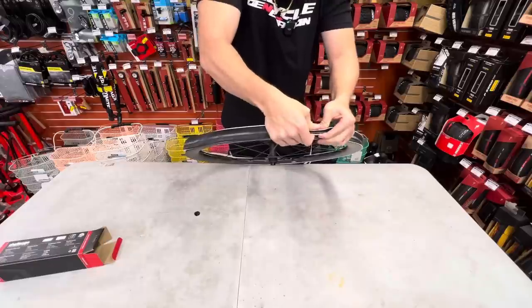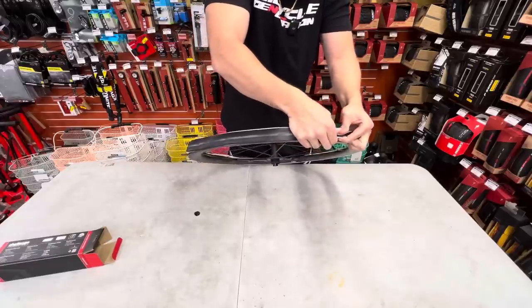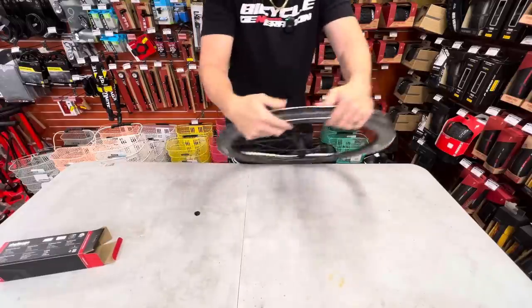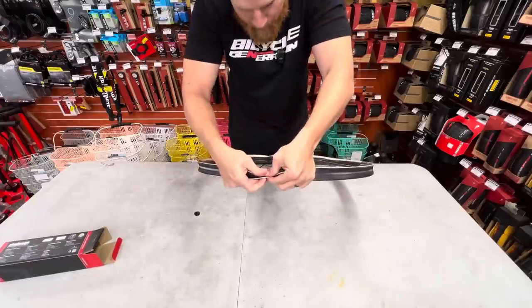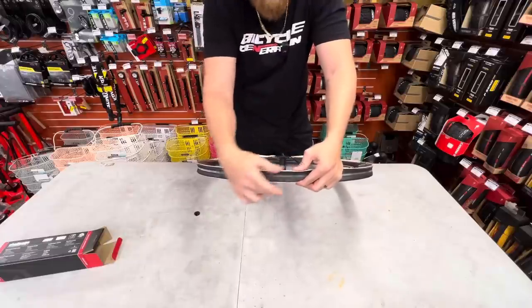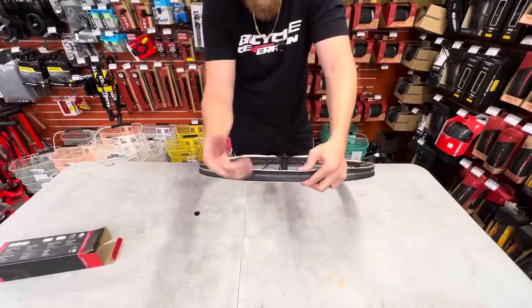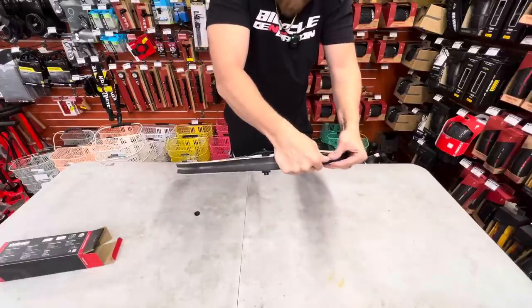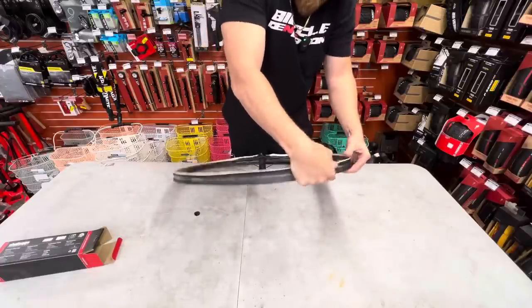Now, this is just me being an idiot and having ego, but if you had a tire lever, you can kind of manipulate this bead a little bit better. I have a feeling I'm gonna end up doing that anyways, but I'm basically trying to move the wire bead of the wheel into the rim channel, okay? Think of me like the ShamWow guy, all right? ShamWow.